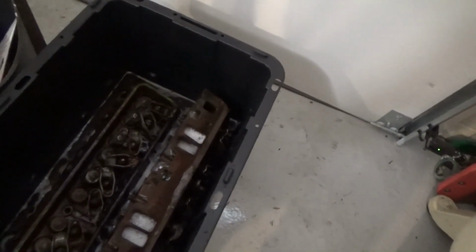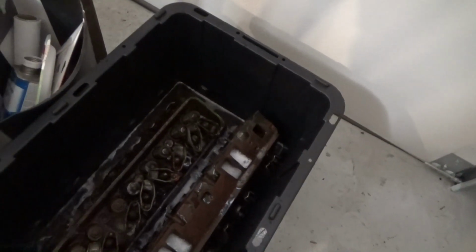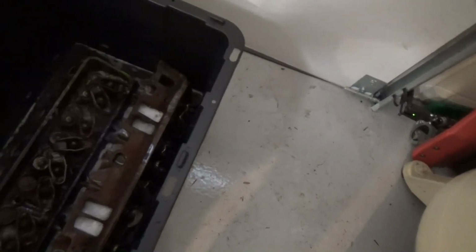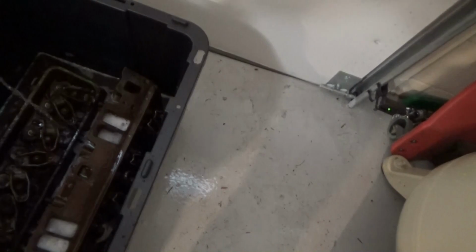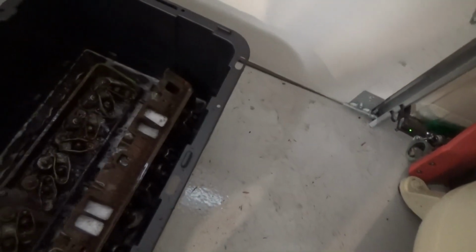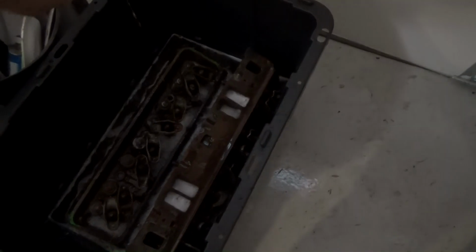I made do by rocking the tub often, flipping the heads over, and switching their position in the tub over the next 48 hours. I then pressure washed the heads and started the teardown. I'll show the results of the POR rust remover in just a minute. Overall, I was happy with how it performed. I just needed more of it, and I'm sure the heads would have benefited from more time in the solution.